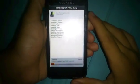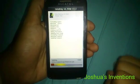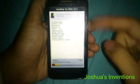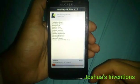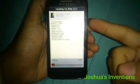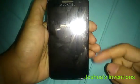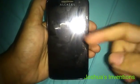You can see it's now installing the APKs. Make sure before doing this that you have rooted your device, unlocked the bootloader, and installed ClockworkMod recovery. Then download the ROM and install it. You can see it's now booting.